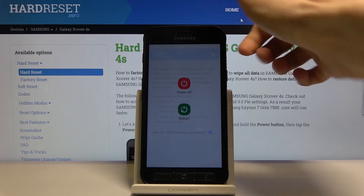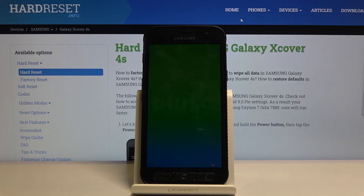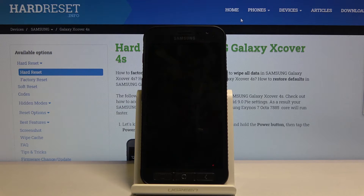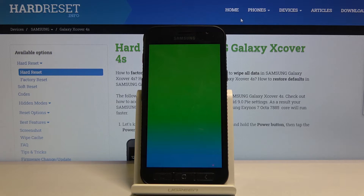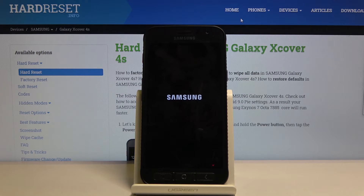Hold the power key and restart. Let's wait for the device to power back on. Once it has, when we get back to the verification screen, you'll see that we can now verify with a PIN instead of a pattern. The PIN will be the one we just chose. Once you get past this, you still want to perform a reset of the device through settings.